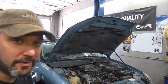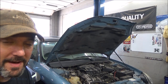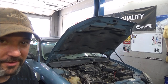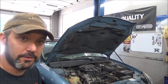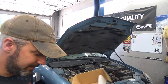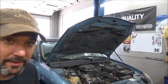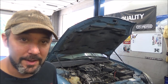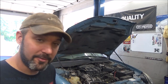There you have it, folks. An '06 Taurus with the classic FS10 five-piston swash plate compressor. It's probably too much information, but that's how you put the clutch on one, or how you diagnose it, or how I diagnose it anyways. It was obvious to me that this clutch had some malfunction other than perhaps an electrical problem. Because some people are going to probably hound me why I didn't go down and test it electronically, experience tells me these have a pretty high failure rate.